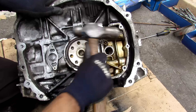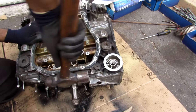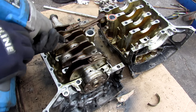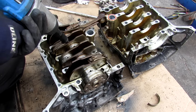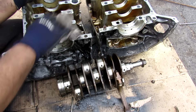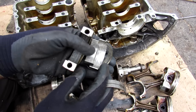Separating the block — here's one half, and here's the rear main seal. Because the pistons can't come up through the block this way, I'm going to remove them downward by disconnecting the connecting rod at the crankshaft and pulling the piston out. Everything got very oily, so I'll wipe off all the oil residue, and now we've got our boxer engine all taken apart.